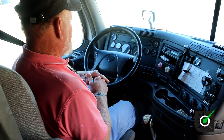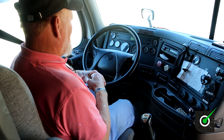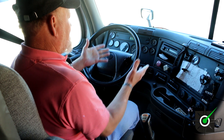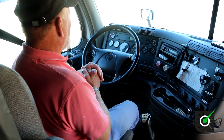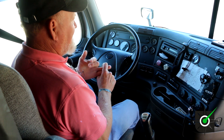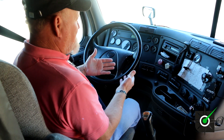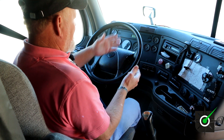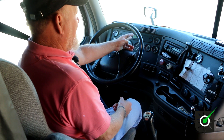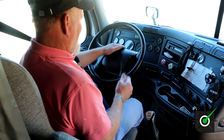It's been long enough — it hasn't moved, so we're going to go ahead. It didn't leak more than four pounds in 60 seconds. Now the second part of the leak down test: you fan the brakes down, bleed them down, pump them to make the warning buzzer and the light come on, and it has to come on before it gets below 55 pounds.